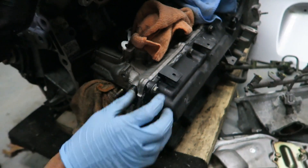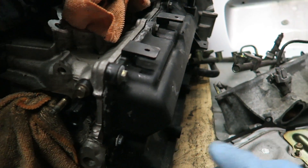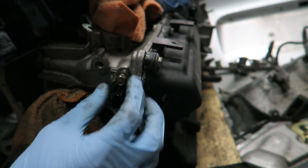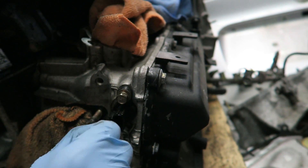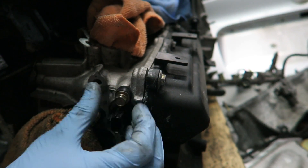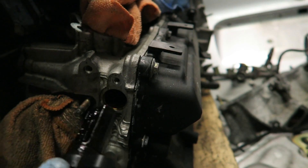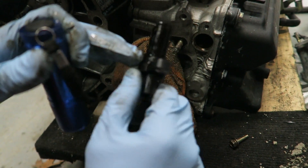Here's a spare motor to show you. This is the passenger side of the motor on the back. You're going to be coming from this angle right here. Here's the sensor we're replacing — you take off this 10mm bolt right here, and the connector is right here. The tab to release the connector is on the bottom side of the sensor. Once you get the connector off, take off the 10mm bolt, then you just pull the sensor out. You can twist it around a little to help pull it out. The only thing holding the sensor in after you remove the bolt is this o-ring right here.